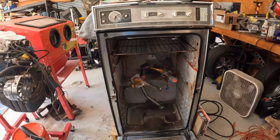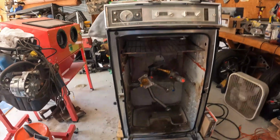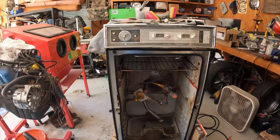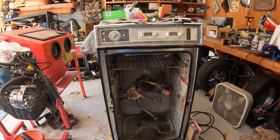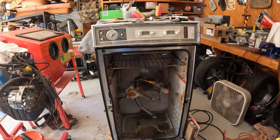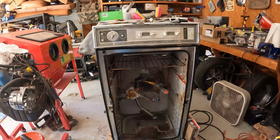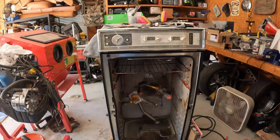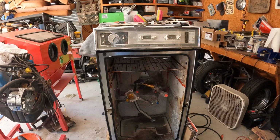Alright, I got them all loaded up there, got them plugged up, raring to go. So again, I'm going to put this at 350 and I'm going to do 20 minutes just to off gas them. This bakes off any fingerprints, any oil, grease, something that I just accidentally might have touched it or something. It just removes any garbage basically. So I'm going to get that going. And I'll bring you back when I got it all set up and cooled off, ready to shoot.